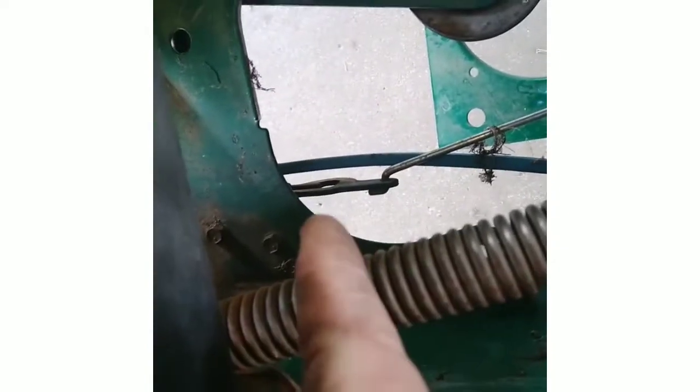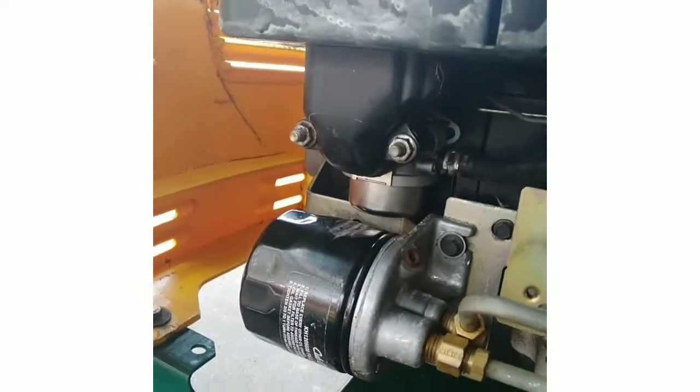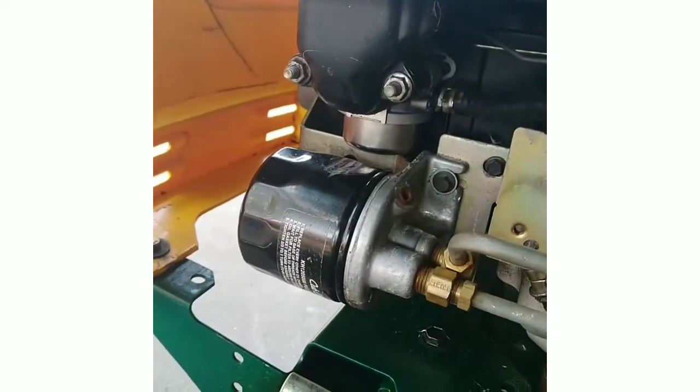Once I get the belt tight on there, it should be alright. Right now it's loose on there. I got it around the hydrostatic. So far it's not that bad routing it. Got it over the fins and stuff, so that should be good. Brake's a little sticky, so I got to spray some lithium grease there. And already put a new carburetor on there from HIPA as well. Alright, little update. The belt does fit. It was a little tight, but of course it's going to be new. I didn't want to wait for a pulley, so I have one. It's a little bit better. I had to shim it, as you can see right there.